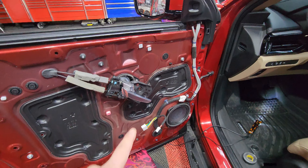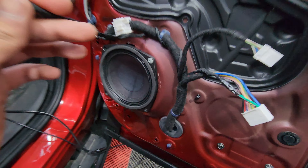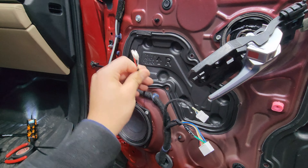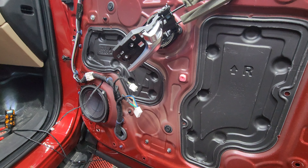For those who want to copy exactly what we're doing here at PMP Customs: make sure your connection is real tight. The green wire on the passenger front side is your constant power, and black is your ground. We don't use the connectors that click onto the wire because over time those get loose — we use straight wire-to-wire connection. We don't cut the wires, we just make a hole in them, put the wire in, wrap it around, and wrap it tightly with electrical tape so it never comes off. Then we put factory tape around it so it looks as factory as possible, and leave it ready so when the door is done with the lights, all you have to do is plug it in.